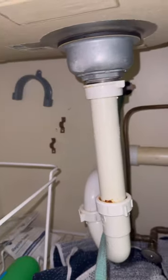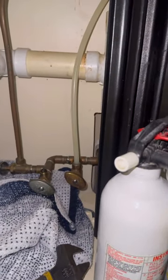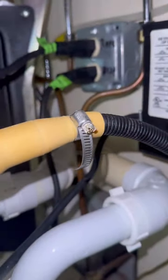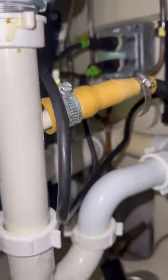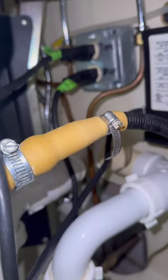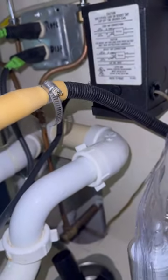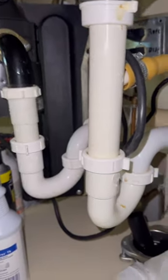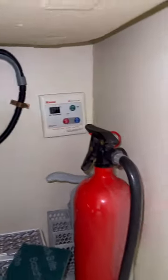We do have two units that we're installing. One is already out, and so here's the other water line. Make sure your water is off. You're gonna have a drain tube, which needs to be removed. You can remove the small connector, which will help it exit easier than that fat piece. Put a piece of tissue or paper towel into the end of that black drain, and that will protect from water leaking out. All right, so that's pretty straightforward, and I'll show you how to extract the dishwasher as well.